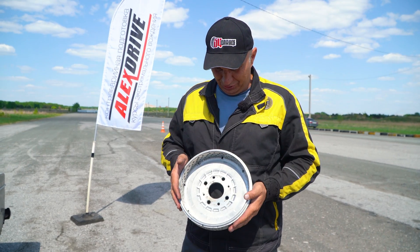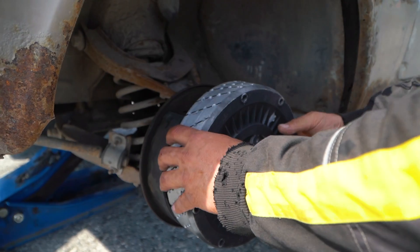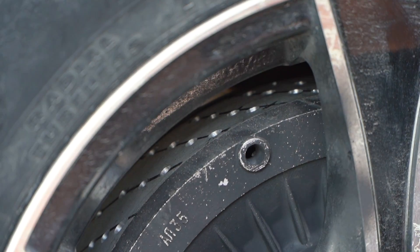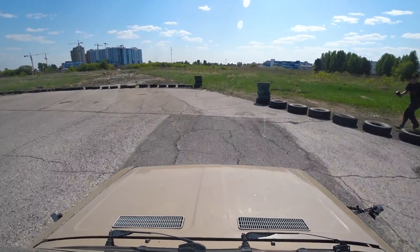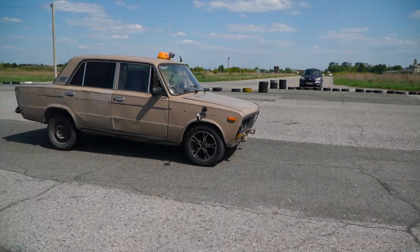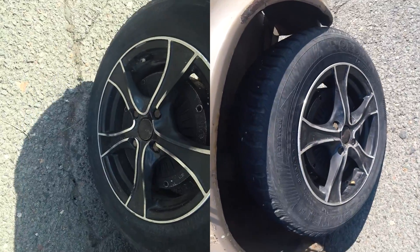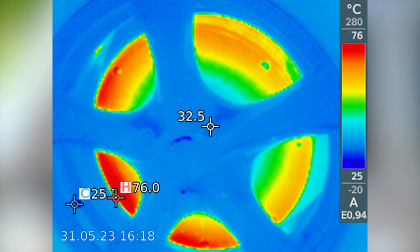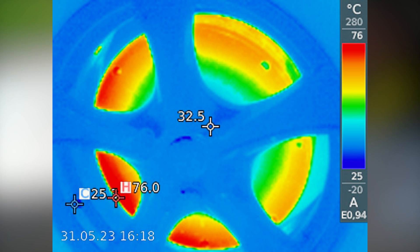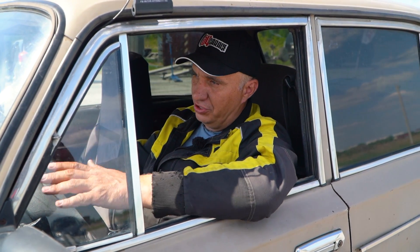Check this out — we've drilled some more holes. Let's install them and see how much better, or contrarily how much worse, they have become. Fit them and head out. 67... 80. Yeah, this time I was so close — I was right on the verge, expecting the wheels to lock at any moment, but they did not. As for the result, I'd say it's about the same. After we did that first round of drilling on these drums: 76 and the other one — 80 and 80. Same sort of heat, they haven't gotten any cooler.